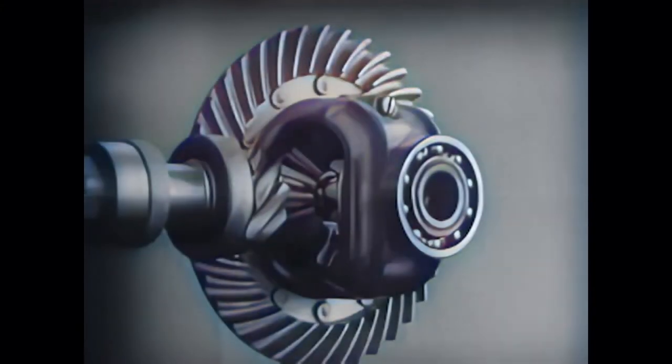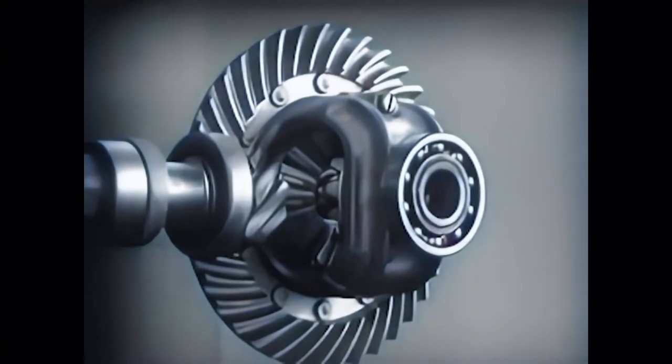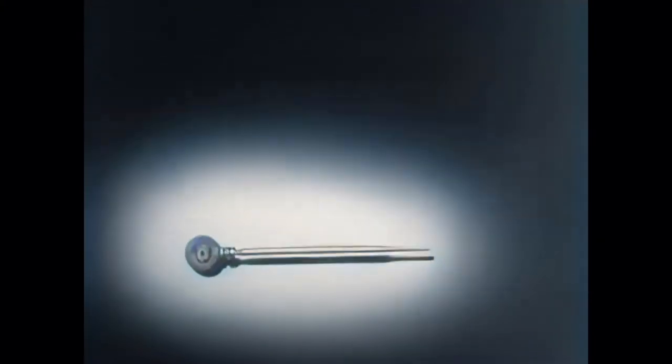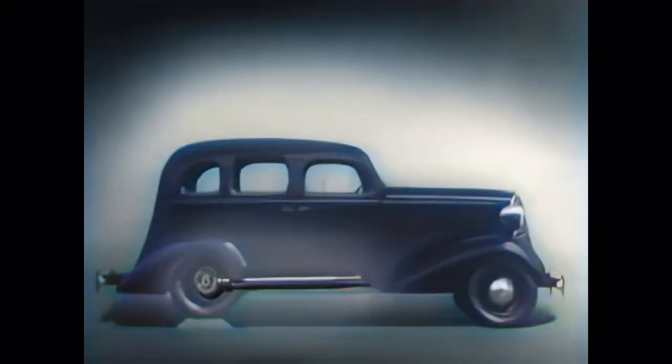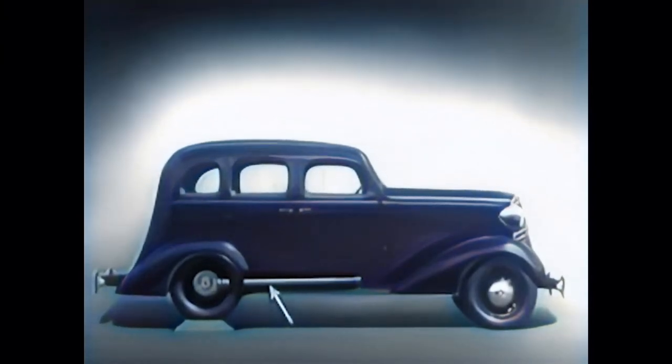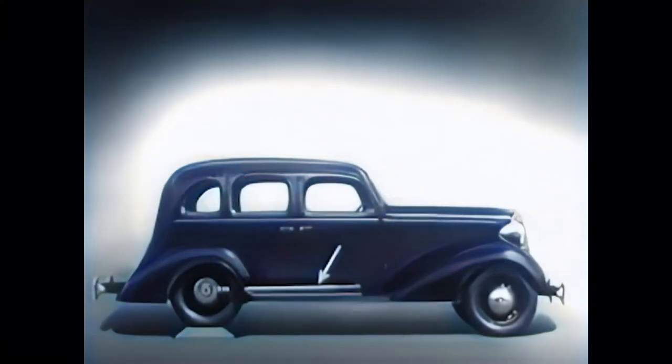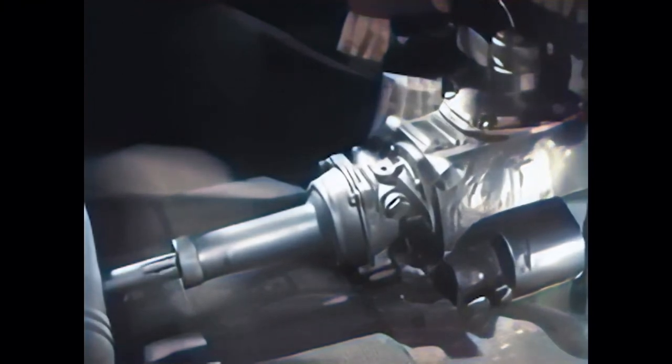We can make our model more compact by moving the gears closer together. When we put our differential in an automobile, we have to leave room for the drive shaft, which carries the power from the engine. We may build the floor of the car above the drive shaft, but if we do, we won't have much room inside unless we make the top of the car high too. Of course we could lower the floor and ceiling, but the drive shaft would be higher than the floor. A shaft in the middle of the floor of an automobile would be inconvenient for passengers and would be awkward for carrying luggage.